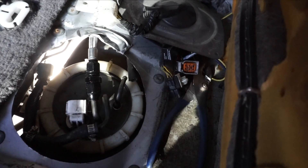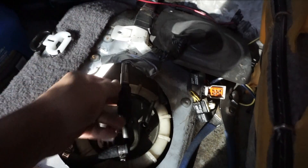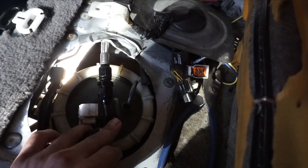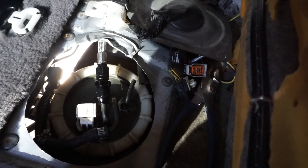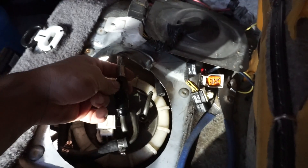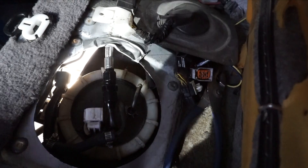Don't connect this line yet because once you connect it, it actually starts pressurizing the system. I learned this the hard way - I connected this line at night and left it on the floor, and when I came back in the morning the car smelled like gas. The system was pressurizing due to California heat and gas was leaking right there because I hadn't tightened this fully yet. So I'm leaving that unconnected until I make sure my whole system is sealed.